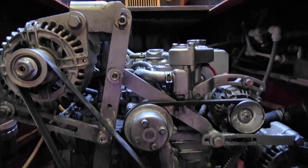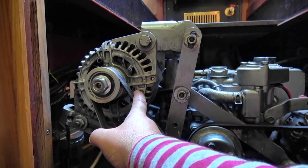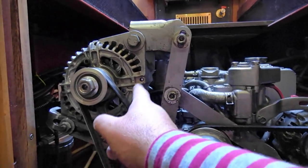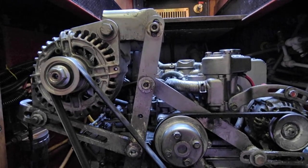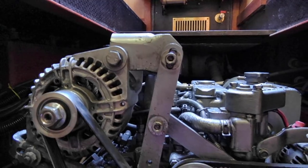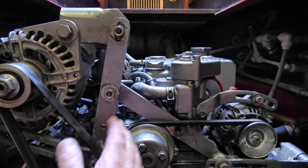If you look here, we have one alternator there that's 50 amp and a 175 amp alternator there. Those two charge our batteries and do very well, particularly that 175 amp one - they charge up quite quickly. Also, not many will have this - we've got run-free pulleys, and that takes stress off everything. When the engine stops, instead of a sudden clunk, they still spin around and gently stop, which lengthens the life of the engine and all this system.